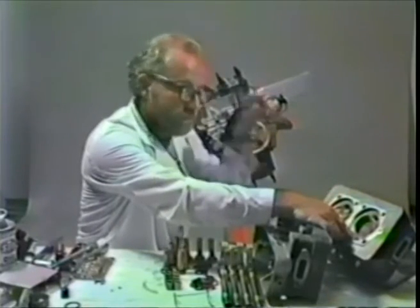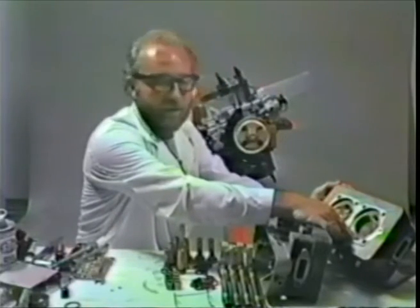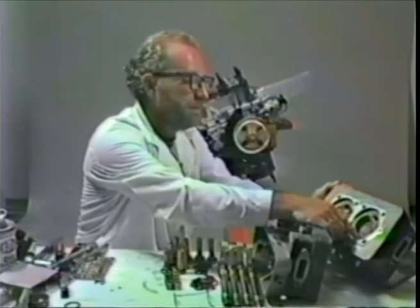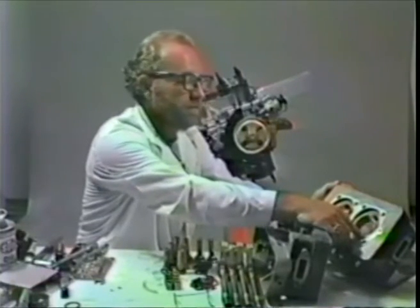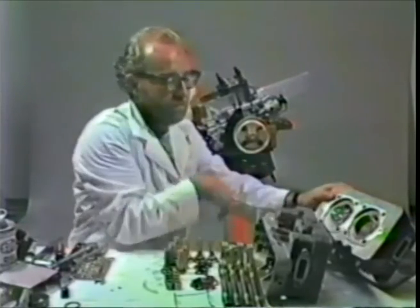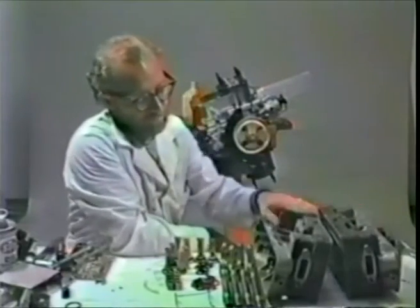Apparently this engine had been overhauled twice before. Once when it spun a rod bearing on the lower end, and once when the piston chunked, probably after it spun the rod. We smoothed that over. We use this on the number 1/2 side, which is under more benign conditions than the 3/4 side. So this is the head we will use on the 3/4 side.